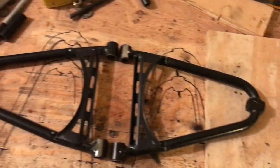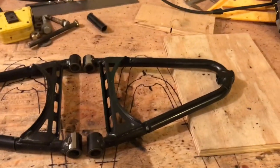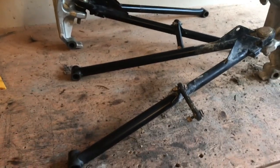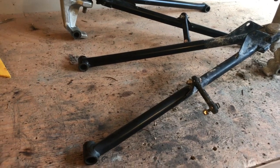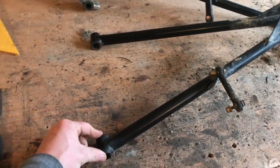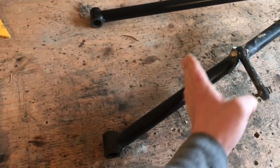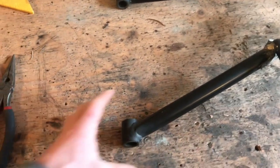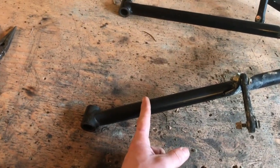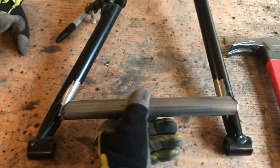And there we have two newly shortened a-arms — they're not perfect but they're very close and they'll work fine. On to the lowers. For the lower a-arms, the process is a little more complex because we're going to be cutting out a section from each arm and we need a way to affix the two points together so that when we cut them they stay aligned. If we just cut them it would be very hard to ensure they go back in a way that fits on the sled. The first thing we're going to do is come out three inches and put a tube across there to brace it.